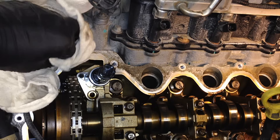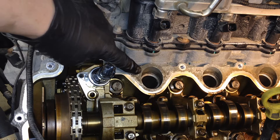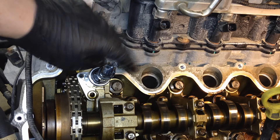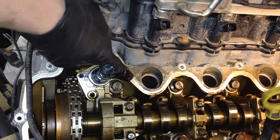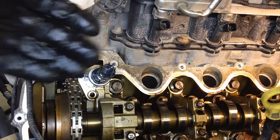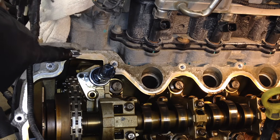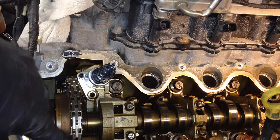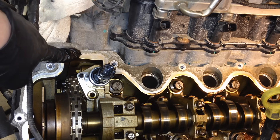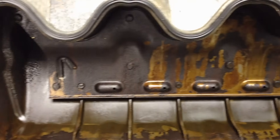Make sure you get your rag out of there. Now we have to clean the valve cover gasket surface area. You don't need to go after all the corrosion and baked-on dirt — just focus on the shiny sealing surface and remove any varnish. Change your valve cover gasket on the valve cover itself. Scrape off the old sealant where the head meets the front cover — one spot here and one down there — and apply black engine sealant. The varnish inside the valve cover is a good indication of the overall maintenance of the vehicle.